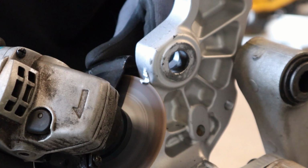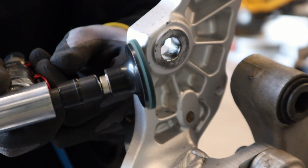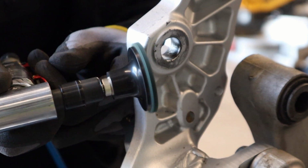It was holding the engine a little bit sideways, and so what I did was actually take a grinder, cut that thing off, then smooth everything out as if it was never there, and that allowed me to get the engine into the frame, push the swing arm main pin all the way through, and guess what? They're the same size. I'm honestly not surprised because, like I said in episode 1, companies don't really go out of their way to make a bunch of different parts. I don't know if the pins are the same exact part number, but it wouldn't surprise me if the 250 pin from the 2-stroke fit in the Z chassis and just bolted right up. We don't really need to worry about it because we're using the 250Z pin.